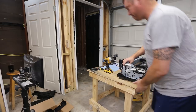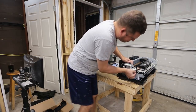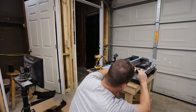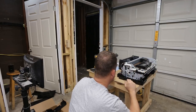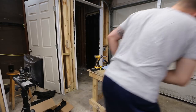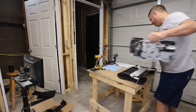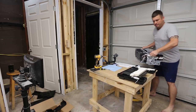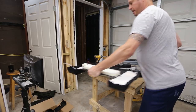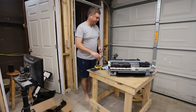There's a tube here that's used for the vacuum pump or the pressure pump, and I'm just going to pop that loose. This side is free, and the other side is free. At this point we can pick it up and scoot it over. We're going to save this and come back to it later — there are parts in there that we need. We're going to work on the automatic sheet feeder, which is the paper feed assembly.